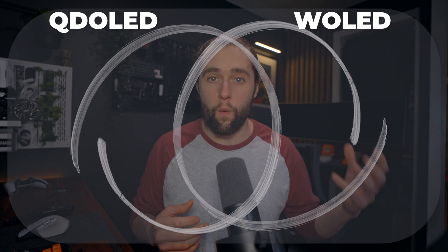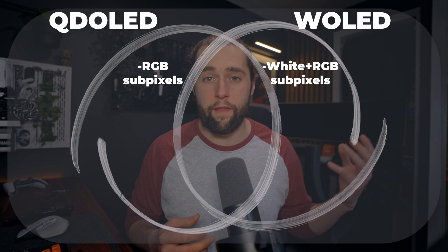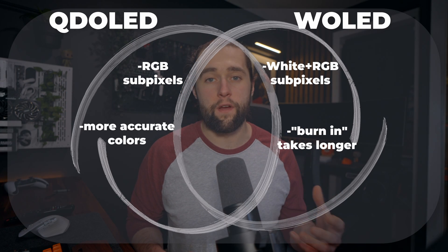Some quick specs: this is a 42-inch 120Hz 4K TV that uses a W-OLED panel, compared to the QD-OLED you'll see on something like the Samsung G9. The main difference is that W-OLED — W standing for white — has a white sub-pixel rather than just RGB. Over time you'll see less pixel degradation or burn-in because when displaying a white image it uses that white pixel rather than brightening up red, green, and blue simultaneously. The disadvantage is W-OLED typically doesn't have as accurate colors and isn't as bright, but to the average consumer it looks just like my other OLED. The only real difference is that W-OLED might look a little dimmer at max brightness, while QD-OLED might suffer from burn-in a bit quicker.